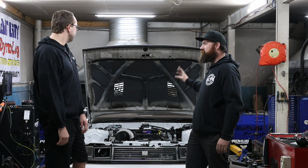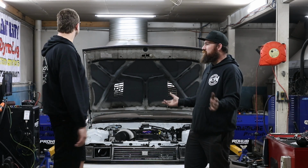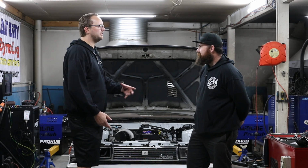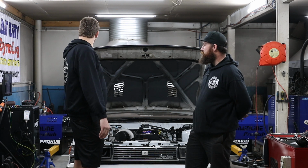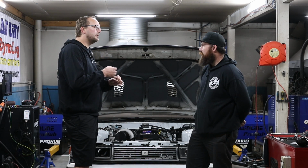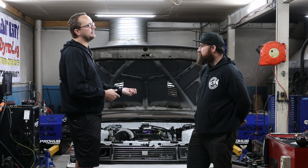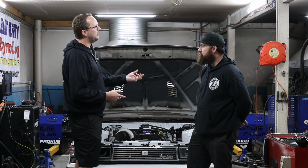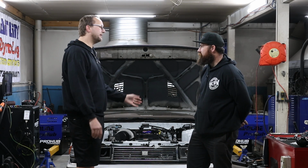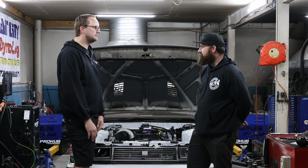And then the hub just makes it so much better for tuning, right? It's super consistent and it just works. So easy, and it's not terrifying as it comes on boost that you think it's about to jump off. We're not blazing tyres like the first time we tried to tune this. And run after run after run, you get accurate 100% power consistency. So I know exactly how much ignition time I need to put in, if the boost is making a difference, not if the tyre's hot or cold or it's about to spin or any of that. It takes all the guesswork out and makes it feel like you're tuning a 300 kilowatt car. It just doesn't matter.